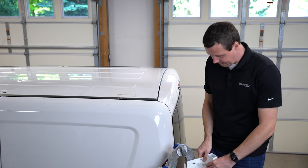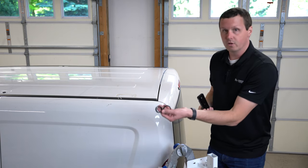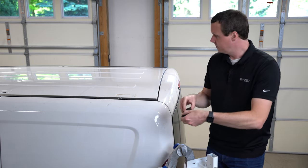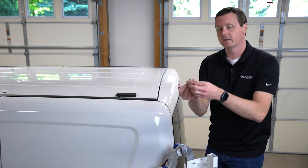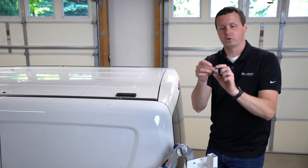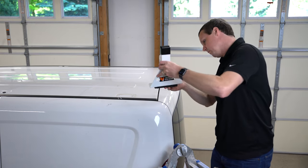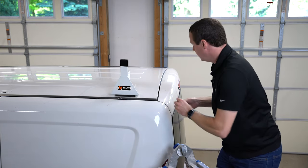The way you attach these uprights is: first, you're going to have this little plastic spacer, and you're going to have two little O-rings that come in the kit. You need to put these in the two outside places on the bottom of it, and then this is going to angle inward over those two holes. Then take one of the hex bolts, a lock washer, a washer, and a poly-foam washer all together on a bolt, and we're going to put it through one of the uprights into the threaded mounting point. I'm not going to get it too tight yet.